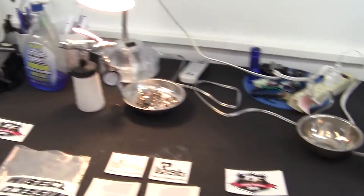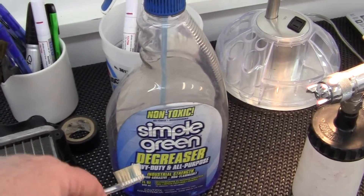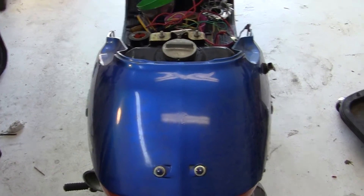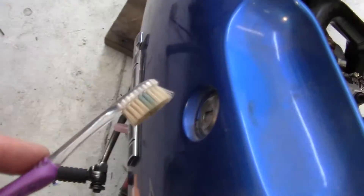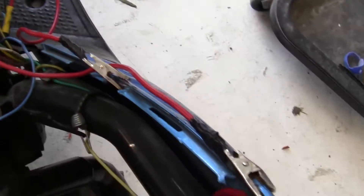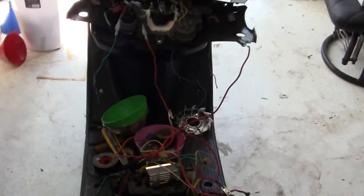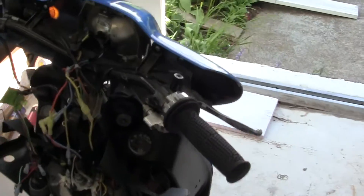So I'm going to take a toothbrush right here and my degreaser, take my parts inside — maybe in a bathtub if the wife isn't home. I'll take my little toothbrush and clean out all the little spots where wax can hide, anywhere there's any kind of white residue. When we go to paint, we're going to paint over the edge and onto the other side. If you're a painter, you'll find that the most common place where things leak or crack is on the edge, because nobody does the edges that well.